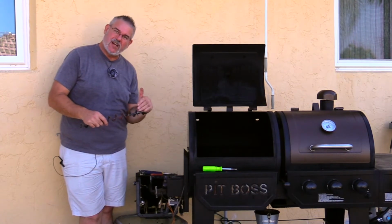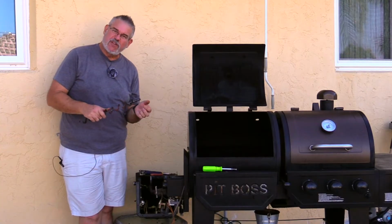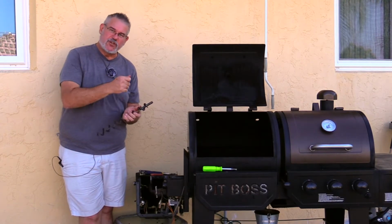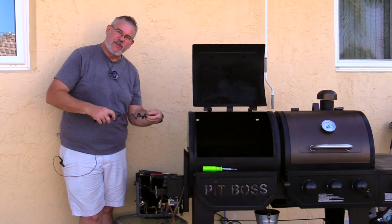I had to take a hacksaw and cut this bushing off of here, this sort of plastic material bushing. When I did, there was a lot of melted plastic all around these tines. I went ahead and pulled this all off of there, used a razor blade, scraped it off, and then I used a wire wheel in my drill to get this part real clear, because that new bushing has to be able to rotate on here very easily.